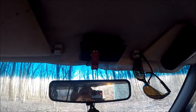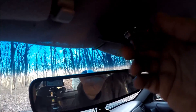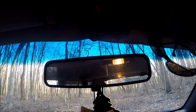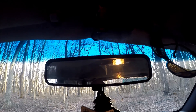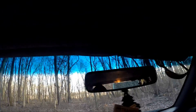Just wanted you to see the mods I've done a little at a time — works really good, pretty happy with the setup. I really like these industrial-duty light-up toggles. This is all wired into a relay so I'm not pulling heavy power on light wire — everything from the relay is heavy wire, and that's underneath the hood.